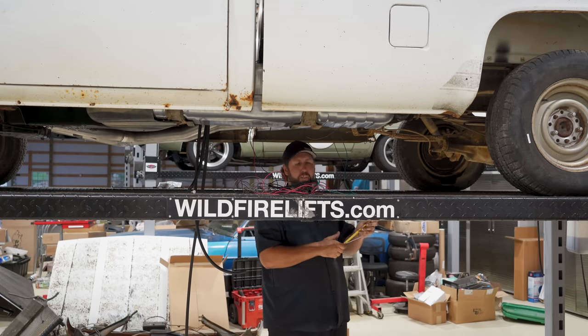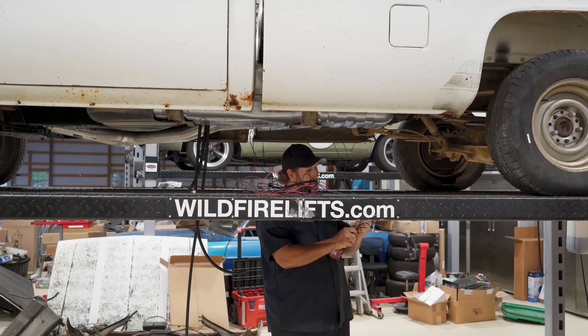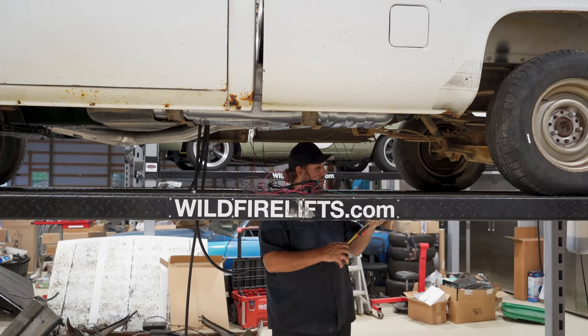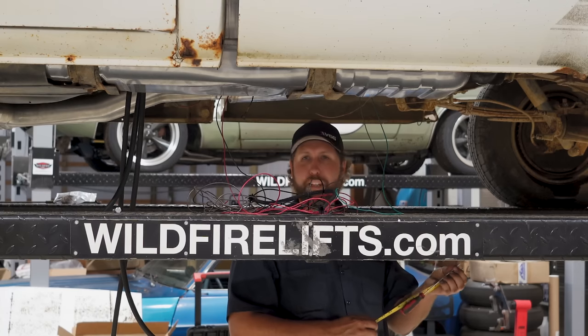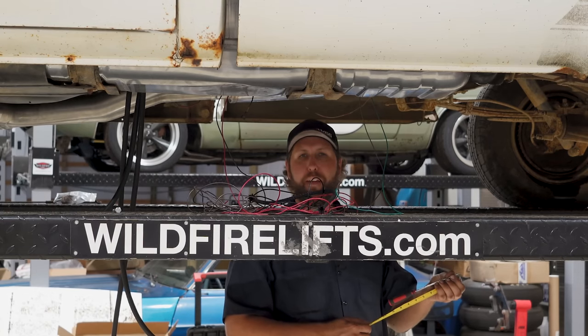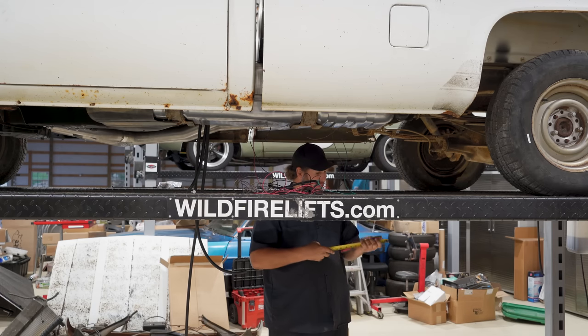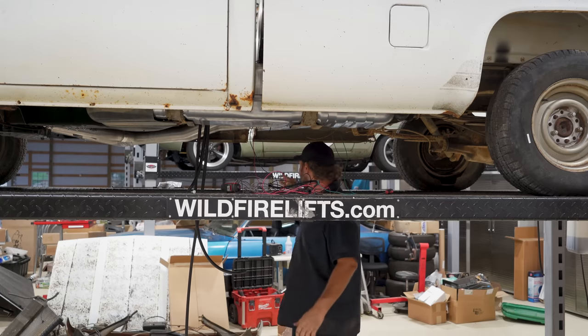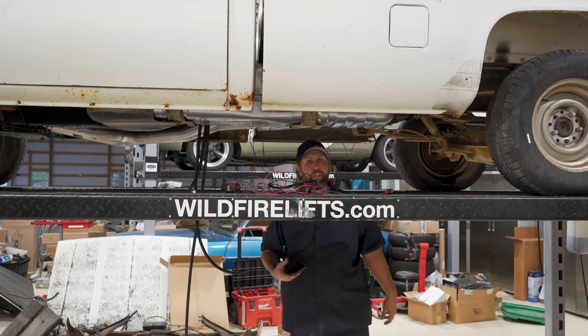As your suspension travels, your drive shaft goes into the transmission. Too long of a drive shaft, you're gonna break the output shaft or the tail housing or bell housing. It's bad. It's the wrong math, is what I'm saying. Okay, what do we got here? 6.5. Okay, that's it. Drive shaft measured.